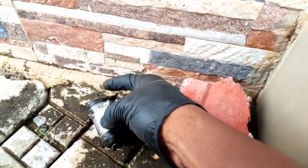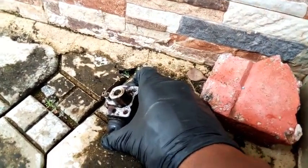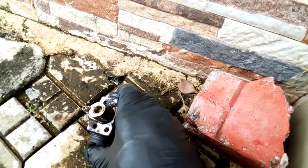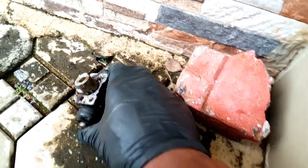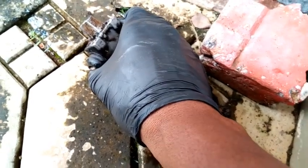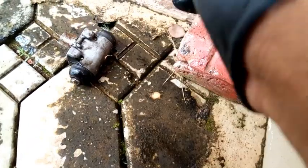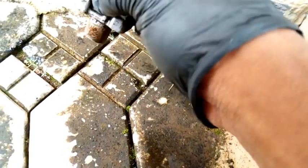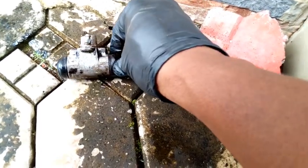And when you step on the brakes, this actually pushes out. There's still some fluid in there, so you can see when I compress this, right? When you step on the brakes, it pushes these things out, these areas between my hands. It pushes that out, and that spreads the brake shoes. What happens over time is that this can get weak and start leaking internally. These are just rubber boots that prevent dust from getting in there.